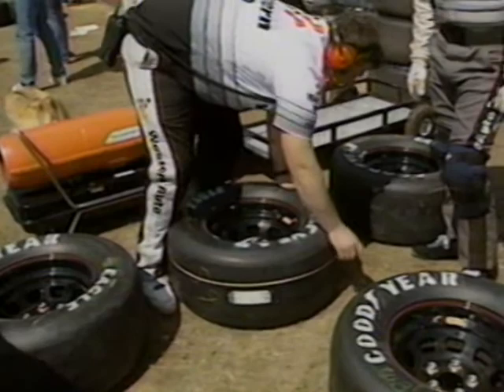So this is just a few of the things that we deal with week in and week out to help make our car go faster for qualifying. When we get down to the chassis part of it, we'll take the tires and inflate them a few extra pounds to make sure they have less rolling resistance. A flatter tire — anyone who's seen a flat tire on a car knows how it makes the car drag that speed down. You blow them up a little bit tighter, the car rolls freer through the corner.